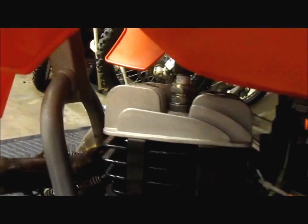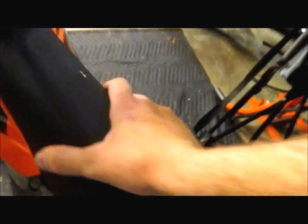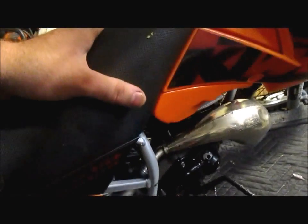We've got this side of it, which the head's on it. I utilize that one head on there just for the time being, and just went that route because whatever makes sense, I guess. I'm probably gonna have to get some different springs. I think this head, the exhaust port, is a little longer than the OEM one, and I really had to stretch out these exhaust springs. But I went and got a new O-ring from Ace Hardware and put some Permatex on it and all that good stuff. Put some gas in there, and I do got a leak that I found, but I'll let y'all hear this thing real quick.